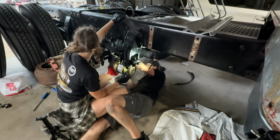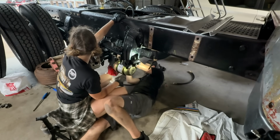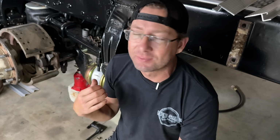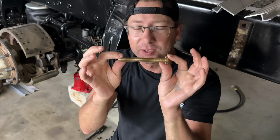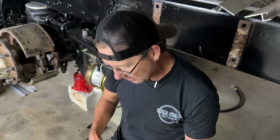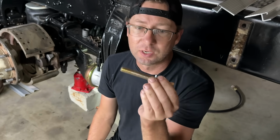There are only like 2 threads available. You really can't make this stuff up. So I'm trying to cage these chambers. This is the bolt that came with it. I thought, well, I'll get online and see what the typical length of a bolt is. 4 13/16. Measure this, it's 4 7/16. I just ordered new caging bolts. For some reason, the 2 that came with these chambers are too short, like a 1/2 inch too short. So we wait till tomorrow. Got to move on and do something else.